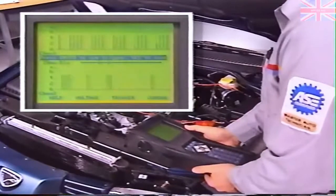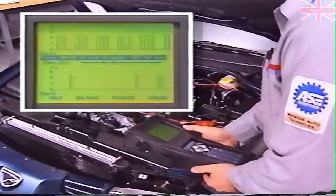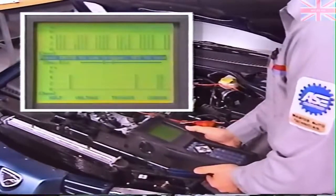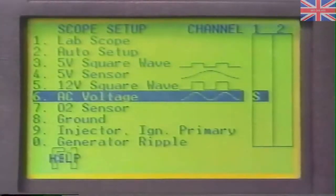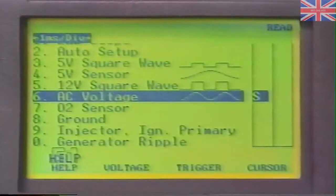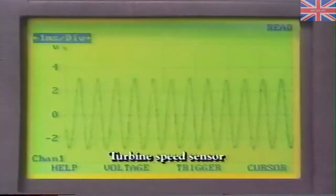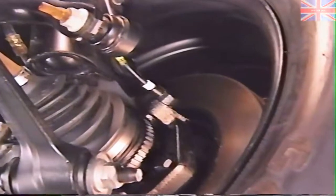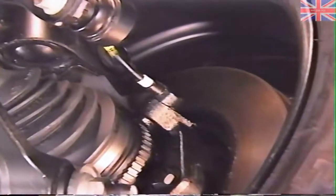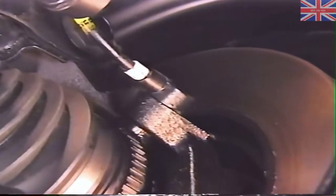The dual-channel lab scope also offers new capabilities in direct signal measurement that weren't available before. Without the PEP module, the DRB-3 was not able to directly measure the signals of the crankshaft position sensor or the camshaft position sensor, making diagnosis of these components difficult. But now with the PEP module, the DRB-3 can directly measure each of these signals, or both simultaneously if desired, facilitating diagnosis of problems associated with cam and crankshaft sensor failures. The new lab scope feature also enables you to evaluate AC sine wave signals, such as turbine speed sensor or output speed sensor signals on electronic automatic transaxles, and monitor wheel speed sensor signals on vehicles equipped with anti-lock brakes.